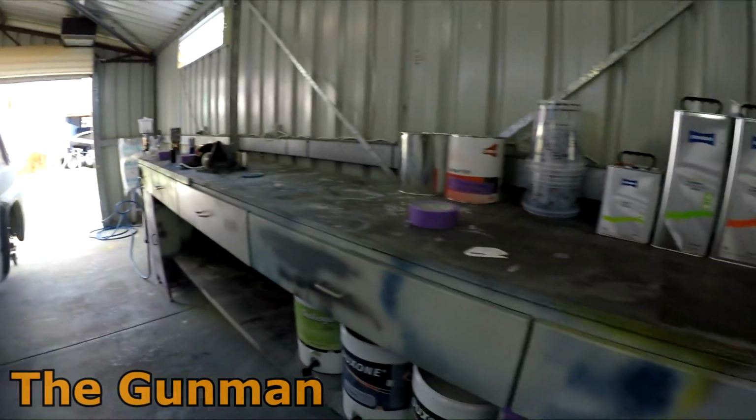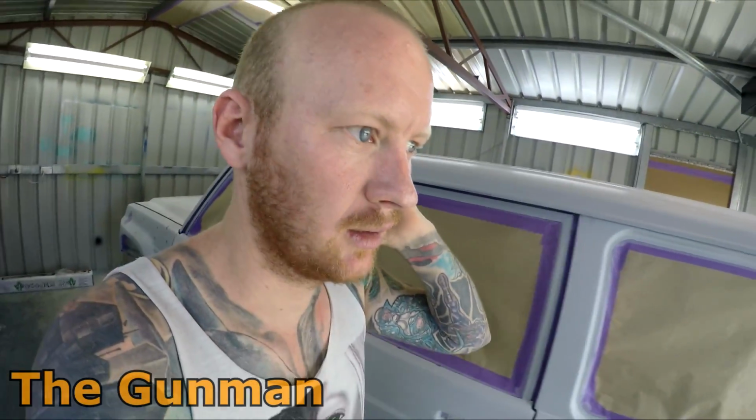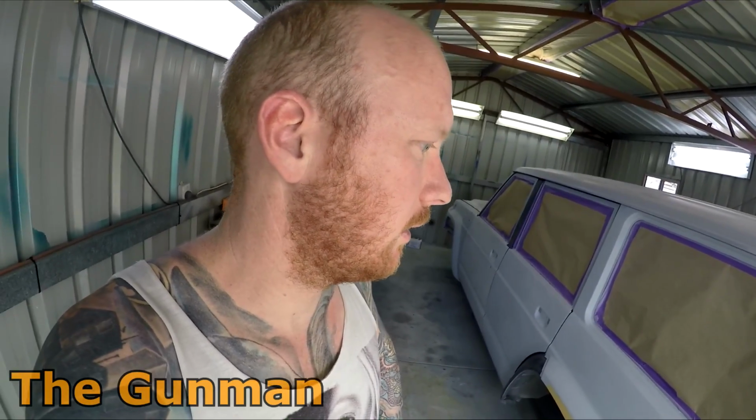And then he went and bought some top quality Standox clear, Standox standard clear with the VOC hardener for the clear coat. So yeah, pretty important to use a good clear when you're painting dark blues and greens, because I've seen them delaminate quite a few times. But anyway, I'll get into the prep styling and see you soon.